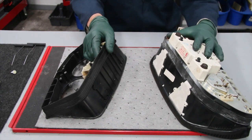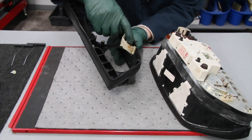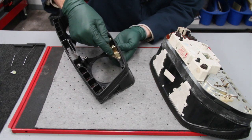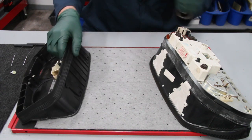Number one is reduction of heat. The old bulbs can get really hot, and as you can see here in this W123 cluster housing, they'll get in there and heat up and melt the plastic where the bulb sits, and it'll get so bad that you'll lose the intensity of your dash lights.